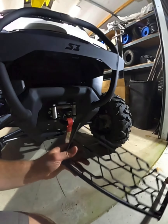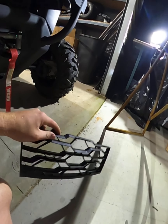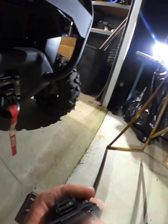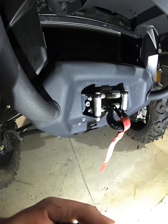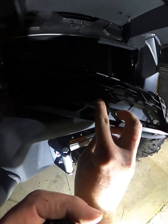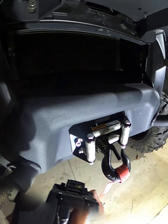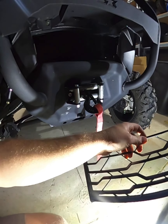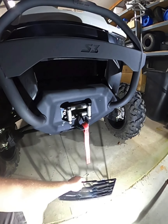Now that this bumper is in here, I'm probably going to have to notch this grill out a little bit, because we want to retain the stock grill — I just think it looks more finished instead of having a hole in here. Being able to use this again it's going to look really nice, but as you can see right up in here we're just running out of room. So we'll get the stock grill trimmed up a little bit and slap it back in there so it looks all nice and finished.